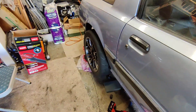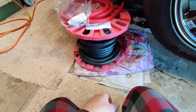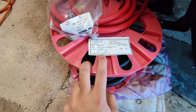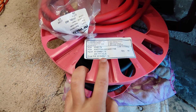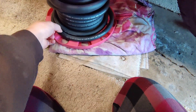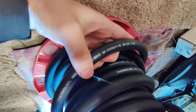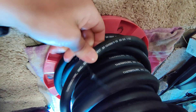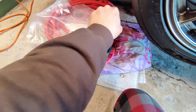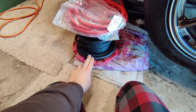One more thing to note is it does come down to the quality of your wire. You can use the audiophile-type stuff. Here's what I found: it's very expensive, but it is really good. It's an M13-486 — 115 is a color. I have a strand of it here: double-aught gauge. This stuff is incredibly expensive, but it will handle over 300 amps. Most of you would only need this — this is a 300-amp system because I have a 270-amp alternator.